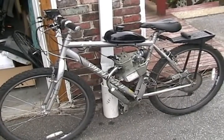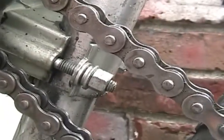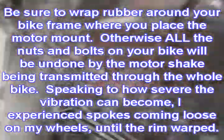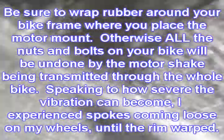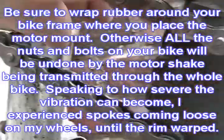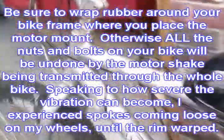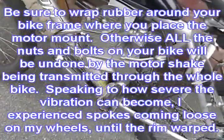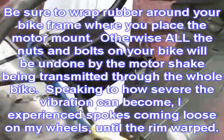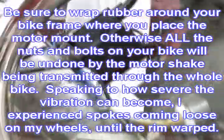There it is, complete — the converted moped bicycle. The first thing I had to do was mount this motor. That's a motor mount right there, and there's the other part of the motor mount. This part should be real easy to get on there. Right now I'm going to replace these nuts with lock nuts I just bought at the store, because they expect you to tighten these up every 10 miles or so. I figure lock nuts will hold a lot better.